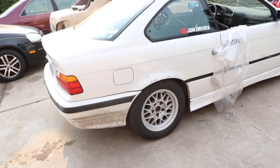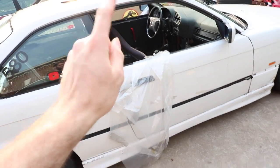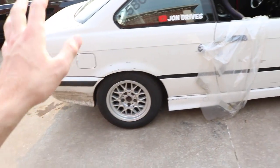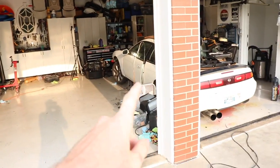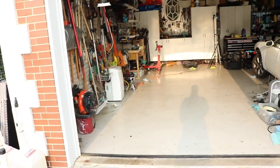If you watched a couple of the videos back, my drift BMW actually broke on me. I believe it might be the slave cylinder or some sort of line because the clutch pedal is stuck to the floor right now. Also, there's just some stuff that needs to be gone over and fixed. Got some parts coming in in a few days and I'm just gonna try to diagnose it tonight. Also, we might finish up pulling the motor in the 240sx. Let's go ahead, toss this sucker in the garage and get started.